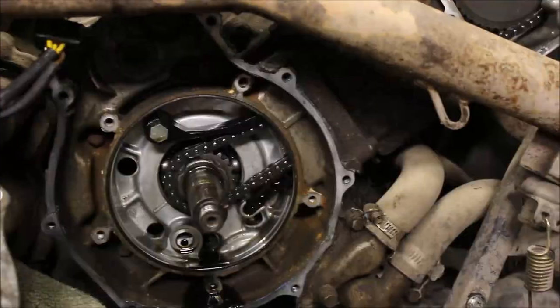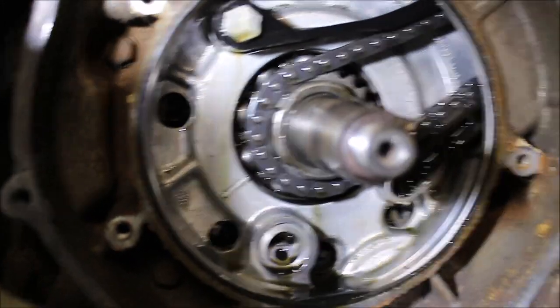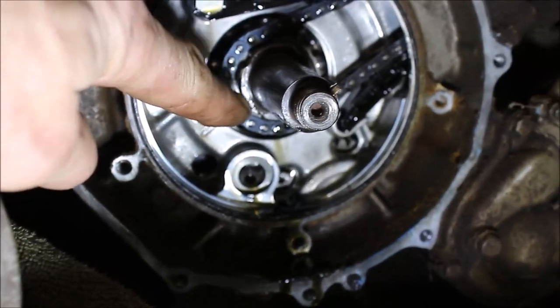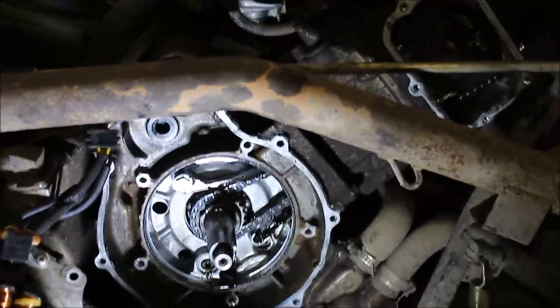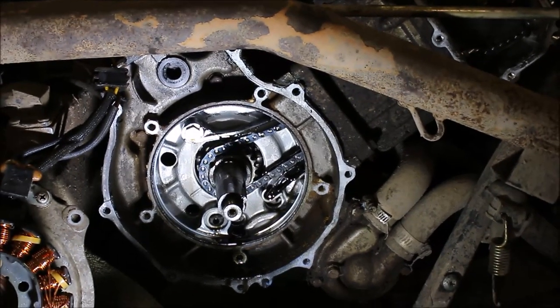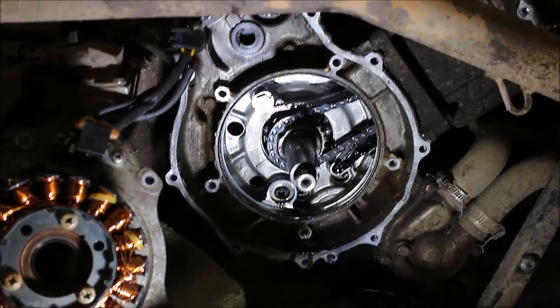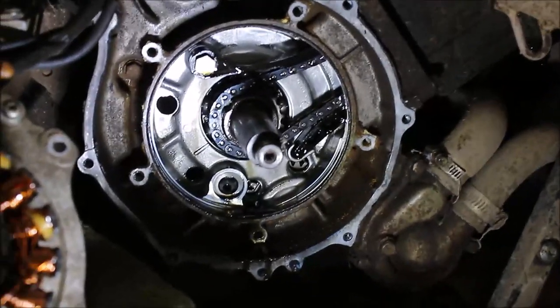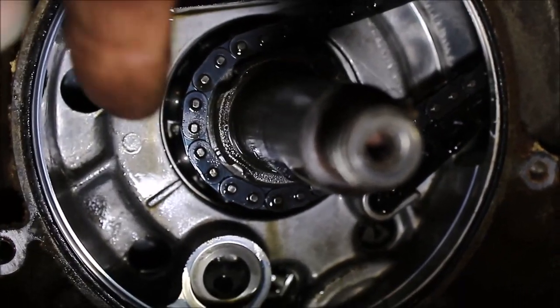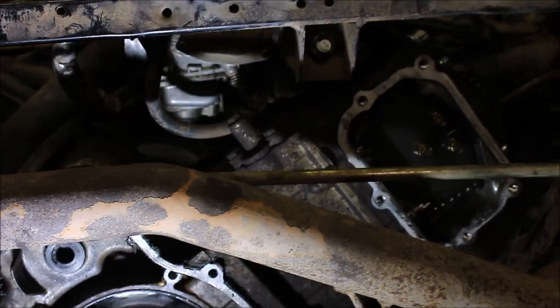I went ahead and pulled the stator. What I'm trying to do is line up the mark on the gear and the two top divots with the mark down here on the case. Once you get the crank lined up with that mark — I have a video on this and I'll post the link — it's actually pretty simple. It's a little messy because you've got to pull the stator off, but then you know your exact position. There's a mark on the case, a mark on the crank gear, and two marks up top.